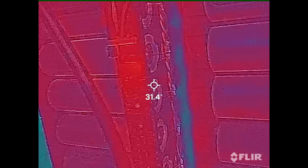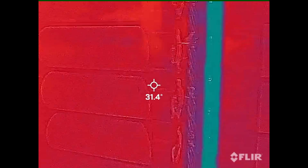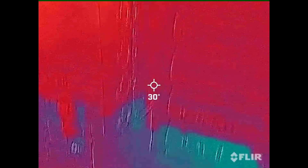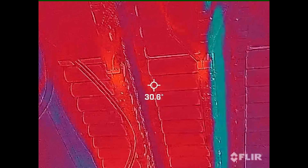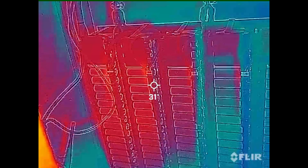There is something back there, I guess. Now, we're at a low state of charge, so it makes it a lot harder to see heat. Because the more voltage we have, the hotter she is. But there's nothing there. So it must just mean we've got a weak battery. We're going to pull it out and check it over.